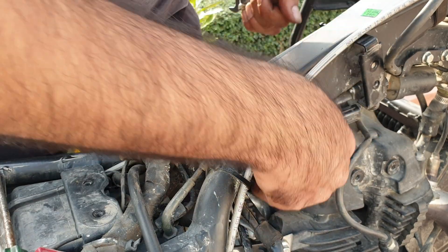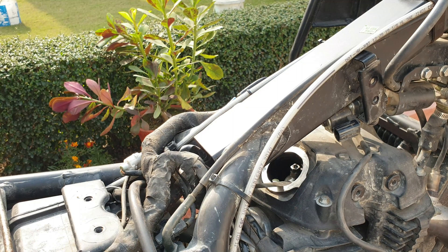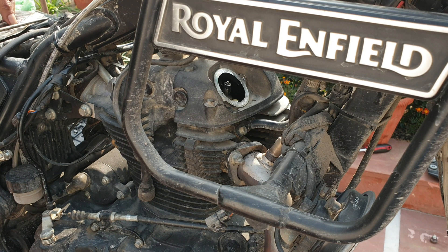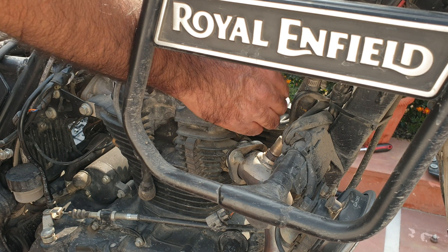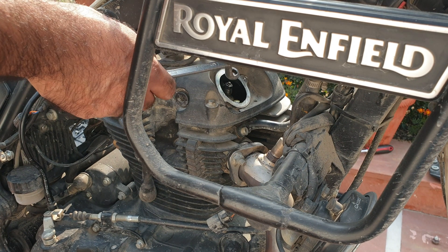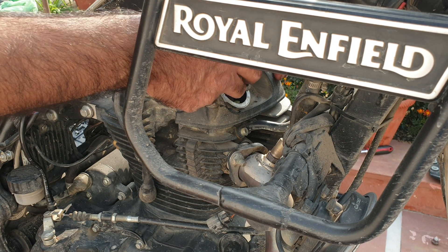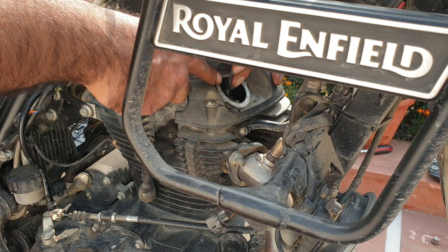There is some drag — perfect. This is what was needed, so the intake is done. Now moving to the exhaust. I tried inserting 25 but it's going slightly in, so for this one I'll be using the ring spanner. I'll hold the tappet holder — don't drop this, I'm telling myself and advising you guys as well — just don't drop anything.